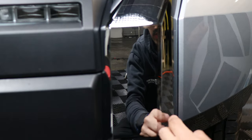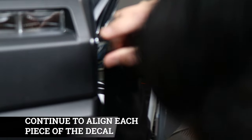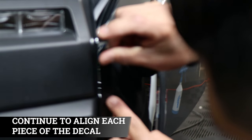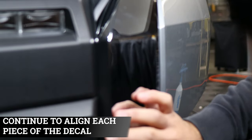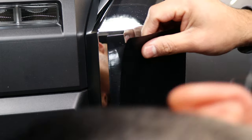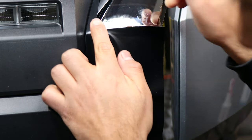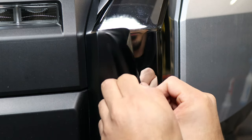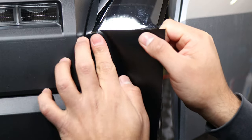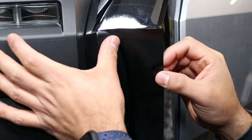Once it's there, go little by little. When squeegeeing, squeegee at an angle with your finger and it should cover all of the chrome. Once you're done with this piece, continue on with the rest — it's just aligning and placing. The inner edge piece, the middle piece covering the center, and the big outer piece all go in sequence. Align each one, make sure it covers the chrome, then squeegee sideways. Pull the film just a bit if you're having trouble after alignment, and go up and down with your finger, making sure you're not going straight toward the film — just side-to-side.